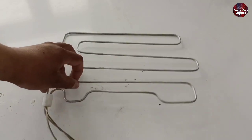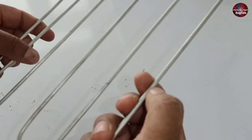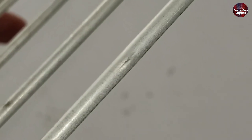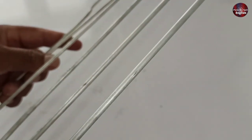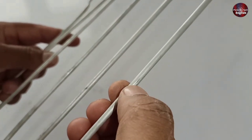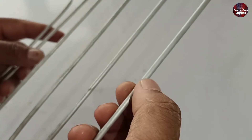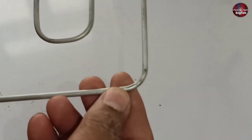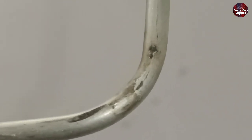I will first of all check the heater physically. I can see a problem here — the heater has been bulged from here. Because when the evaporator is cold, it does not make such a problem, but it has been damaged here. It seems to be a minor damage but actually it is a major issue, because when water flows through the heater while melting the ice, it will short circuit. The heater from here also seems to be blown up.